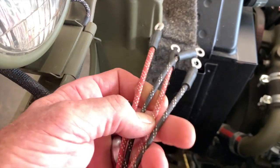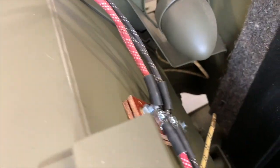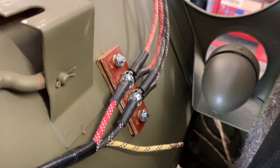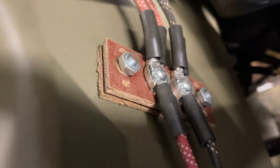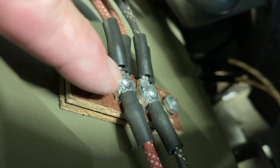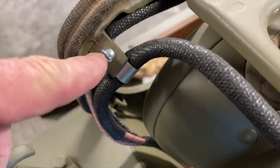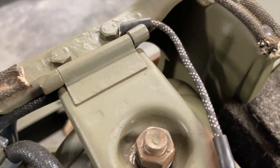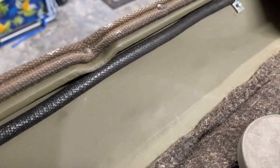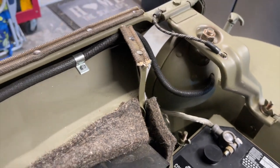Once you get to that point, each one of the leads has a red and a black wire with white tracers, and we're simply going to connect those to the little block we installed in the previous video — the same way. We're going to put the two reds that match the red on the top, and those go in at almost a 15-degree angle but have to fit inside that protective collar. I've got the two eyelets pushed together inside that little space, and it lines them up nicely. Also note the star washer that's between the head of the screw on your two-post block. There we are on the passenger side.